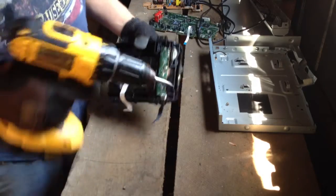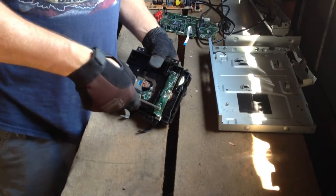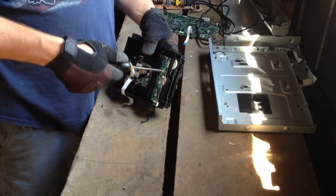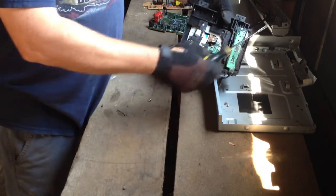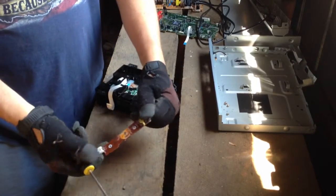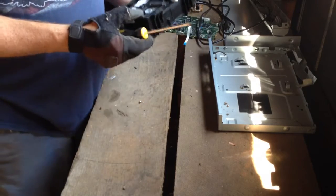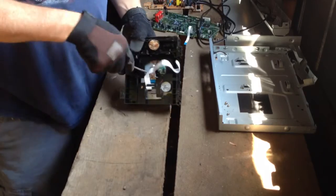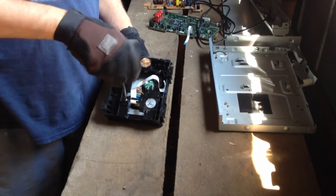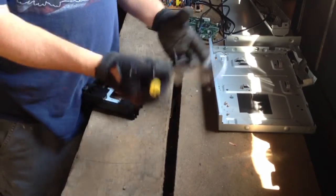This board here — just a couple of screws. Take those screws out and that board should come off the back pretty easy. Sometimes they'll be soldered to that insulated motor that's in there — some of the cheaper ones will be that way. It pops right off. And that again is going to be a brown-on-green, so it really depends on who you sell that to whether it's going to have any value or not. Inside here is your reader. Some of these laser readers are going to have gold in them — not a lot — but you want to make sure you take that out and have that ready to go to your e-scrap buyer. A lot of this plastic you set aside. Some e-scrap buyers will buy these ribbons in bulk, but you've got to have a whole lot of them to get anything really worthwhile.